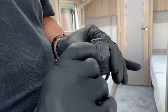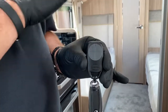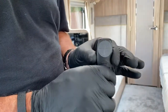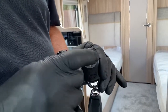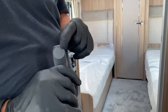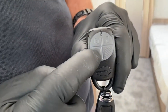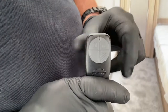The flat triangle — not the one with the knurling, but the completely flat one — if you press that you get one beep. What it does is arm the exterior of the caravan: the tilt sensor mechanism is active but not the passive infrared detector. So if you've got an animal kept inside the caravan and you're just going to a local shop for provisions, having left a dog or cat inside, press that one. One beep means you've deactivated the PIR but you've still got the tilt sensor active.